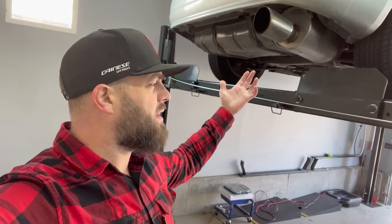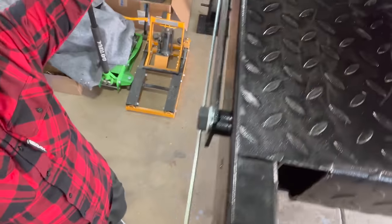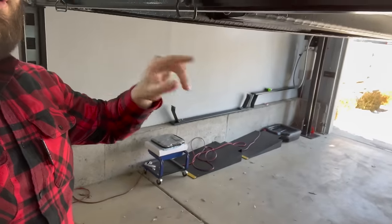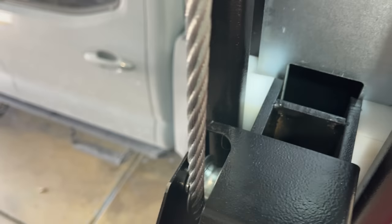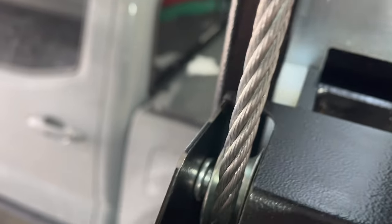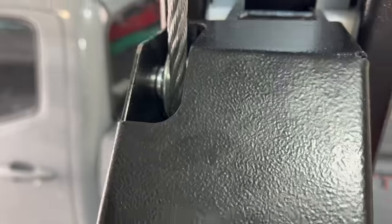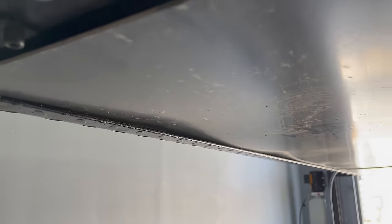That's kind of it for tips and tricks. One thing to note: the ramps hook into these spaces we put on midway through — when you're down and pulling a car on and off, the ramps just hook in right there. One major thing: make sure you run the cable on the inside of the pulley, not the outside. It feels like it should go on the outside, but it does not — make sure it goes on the inside of that pulley closest to the car, on all four corners. There is a tube inside this cover — when running the cable, it needs to go through that tube. It'll work fine without it, but I recommend it.